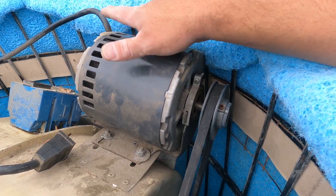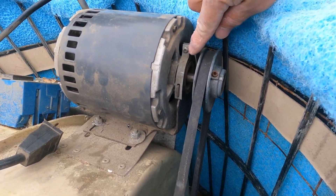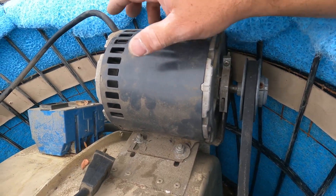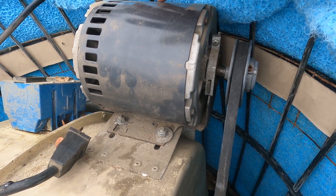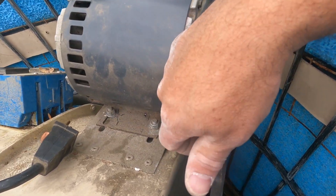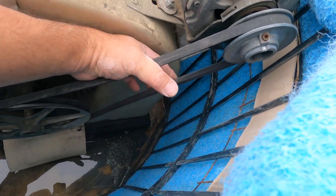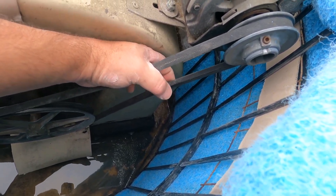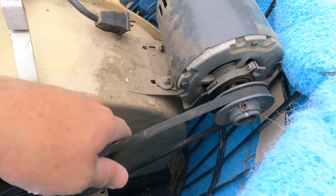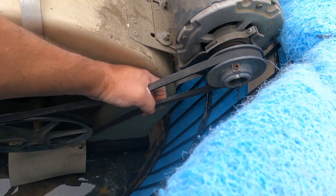Today's video is to replace this motor — it's not difficult. You've got these two clamps on both sides; we're going to remove those, remove the belt, and replace it. The most important thing is to make sure that the belt is nice and tight, or semi-tight, when you put it back on. As you can see with the original, there's just a little bit of slack — not much. The motor will vibrate with it, so it does have a little bit of play. That's about as much slack as you want.